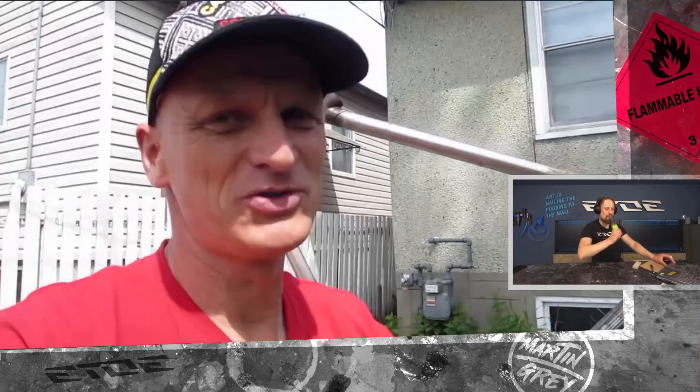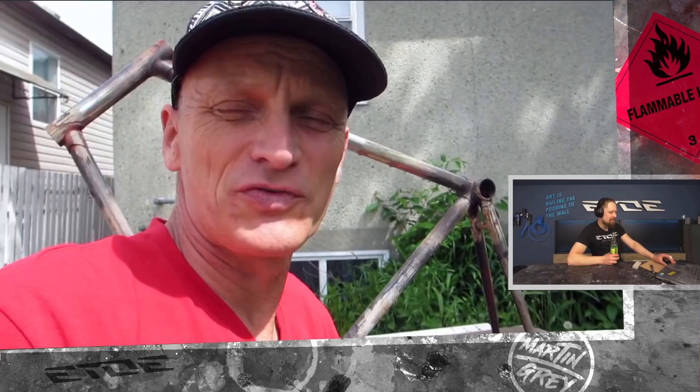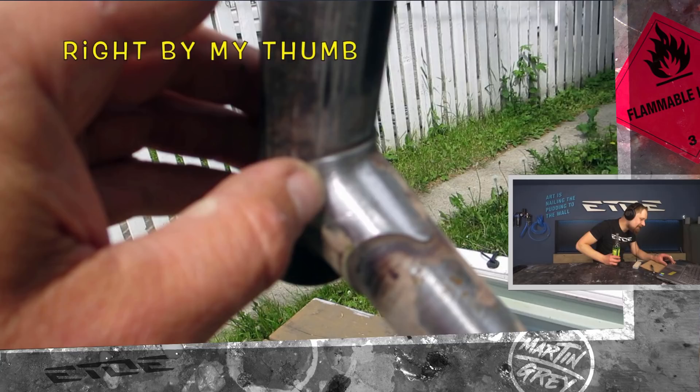Well, this is how I enjoy my bikes — I build them. I got this piece from our community bike shop for free. There is suspected to be a tiny crack in one of the lugs. Can you see the crack? I think that's only a scratch. It doesn't look like a crack. It's not common that a lug cracks in this area. And even if it's a crack in the lug, it's not so bad because these frames are fire-brazed, and it doesn't mean the frame is no longer rigid.